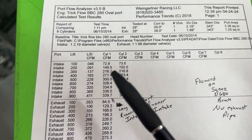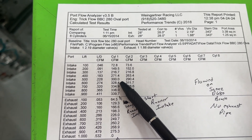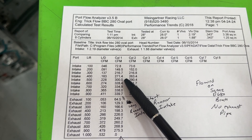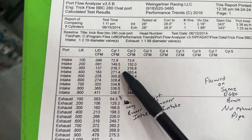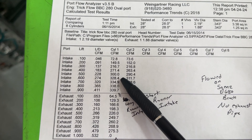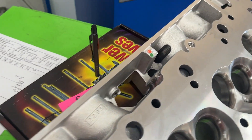The numbers are great — this is amazing. Trick Flow is known for having great numbers at 0.400 valve lift no matter what make of head they're on — Ford, Chevy, whatever. We're looking at 271 on a 4.310 bore on the long runner — that's great — and 263 on the short runner.